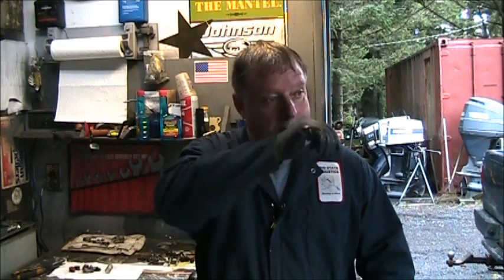Okay, so I finished up the little Yamaha as far as the owner wanted me to take that little 8. I'm waiting on a head gasket for the 55 commercial. The little cutie 5 1/2, I will call the owner and say, how much do you want to spend? It needs motor mounts. It needs a new head or a Heli-Coil, which I can do. I have those. But it's just how much do you want to spend? And even if I put a Heli-Coil in there and take care of the plug, is it going to run on that kind of compression? So, what do you think?